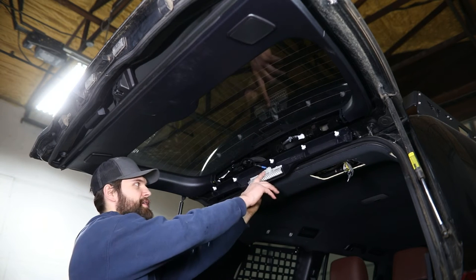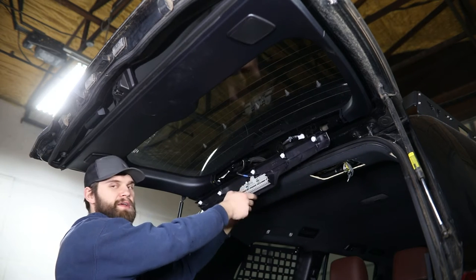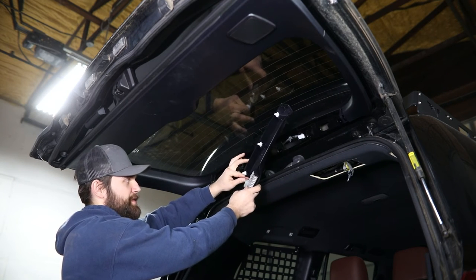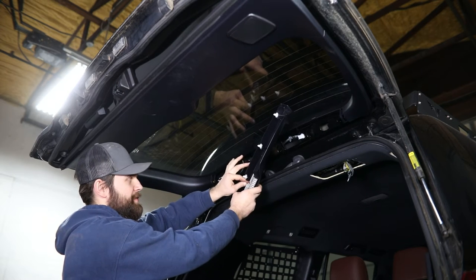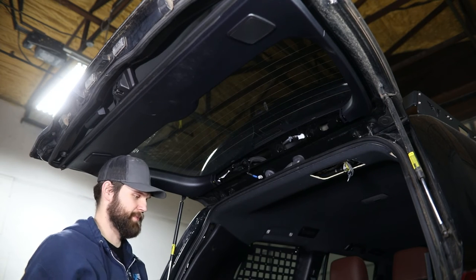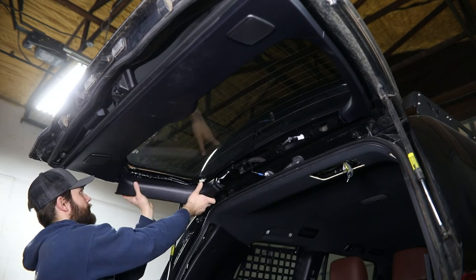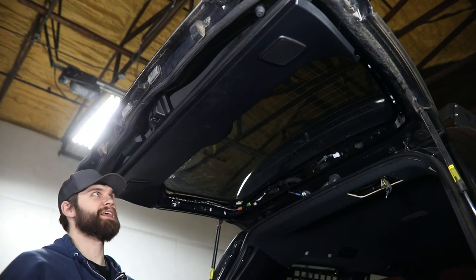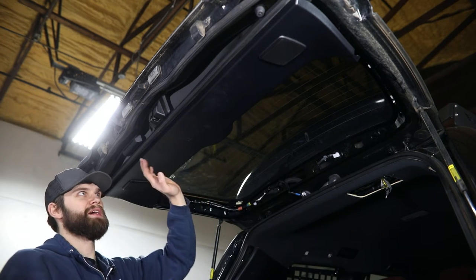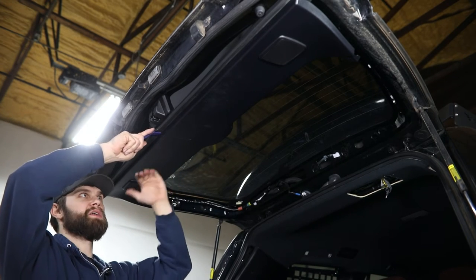Once you get this pulled free, don't pull too hard. You need to be careful because your third brake light is mounted in here and obviously the wiring runs to that. You're going to need to unclip it here — that's simply a little thumb tab you need to press in, and then you should be able to slide that connector back, allowing this to drop free. Then you can work your way around to the sides and remove both of these cover panels. Lastly, you're going to need to remove this bottom cover section, which is just held in with plastic clips all the way around. Get under this seal with your pry tool, locate each one, and pop those free.